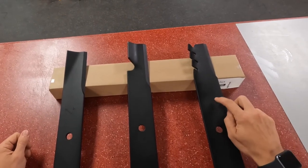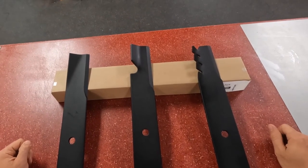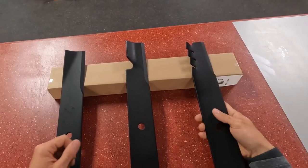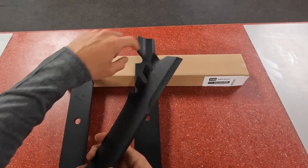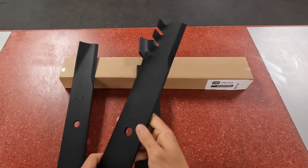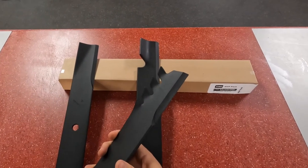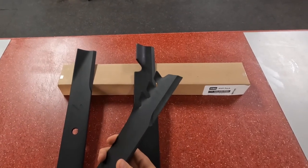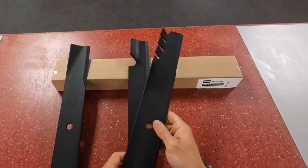Some times where you don't want to use this blade — like here in Ohio, if you've got a lot of thick wet grass and you need to throw it as far as possible, this isn't going to do that. These cuts here in the sail allow air to go through, which limits your airflow. Also, in dry summer conditions, these teeth are going to cut the grass so fine that it makes it really hard for the deck to throw it. So these are a great blade, but only in the right use.